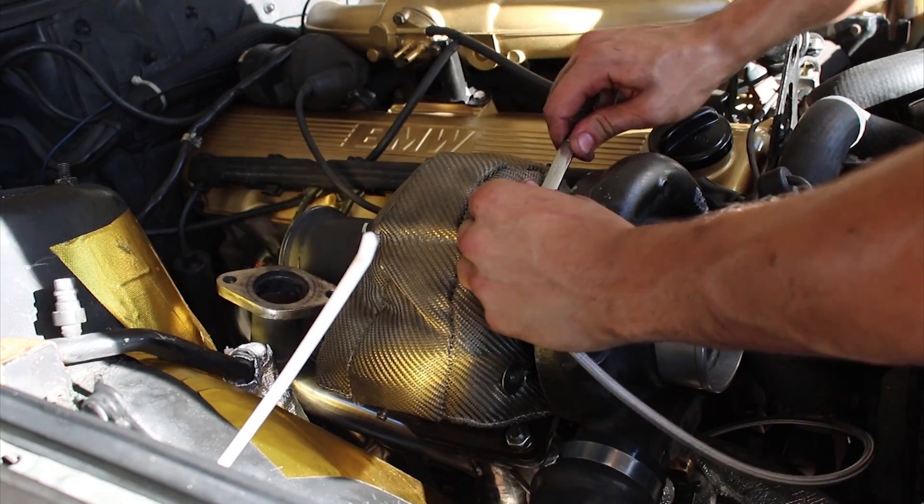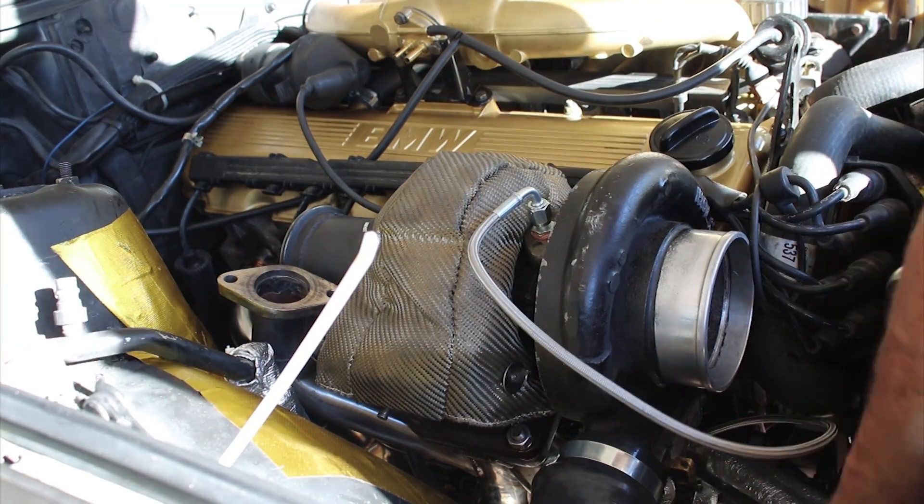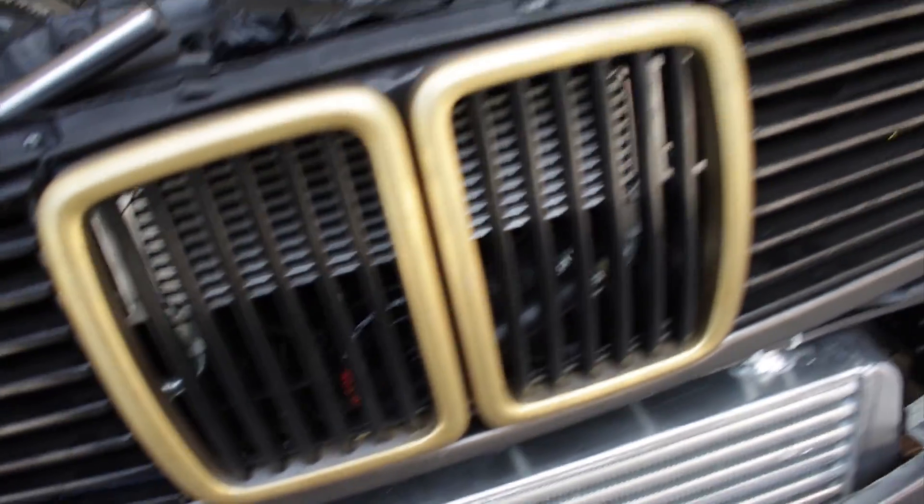Just tightening down the oil feed right now — everything's looking pretty good. The whole oiling system is done: I've tapped the pan, put the fittings in, done the drain, done the feed, and did the oil cooler. It's been a big couple days and it all turned out really great — it tucks up nicely in there. The turbo is hard mounted, just got to finish the downpipe and that normal stuff. Step by step we're knocking it out, getting ready to fire up real soon. Stay tuned, remember to like, share, and subscribe!